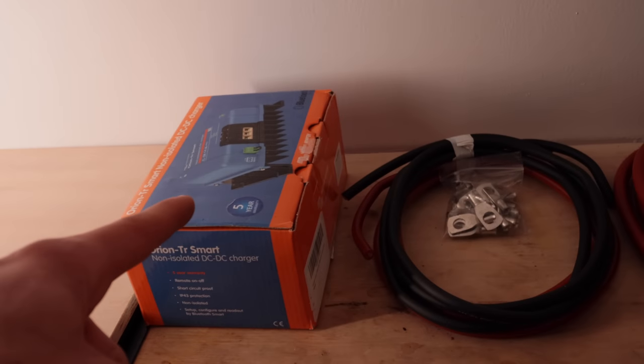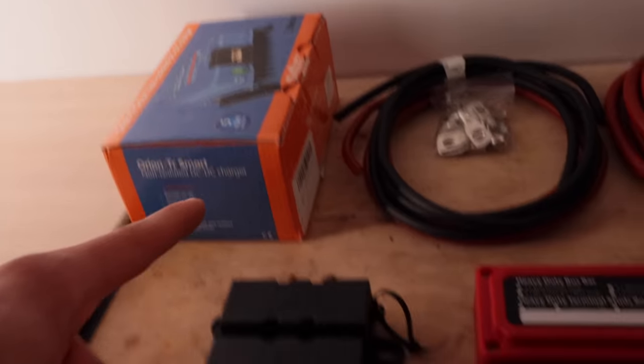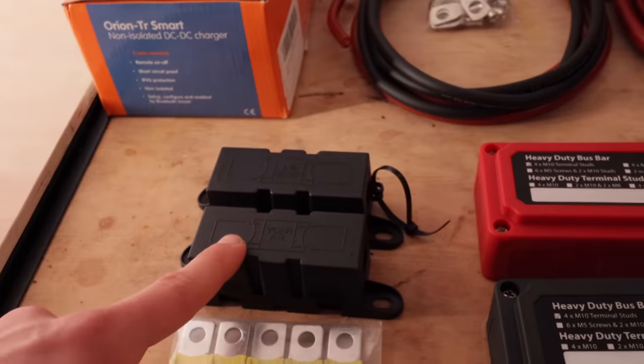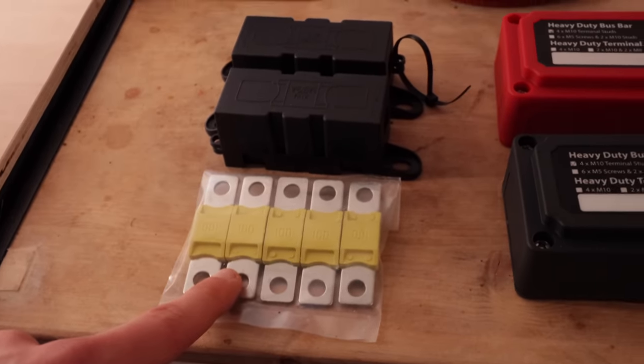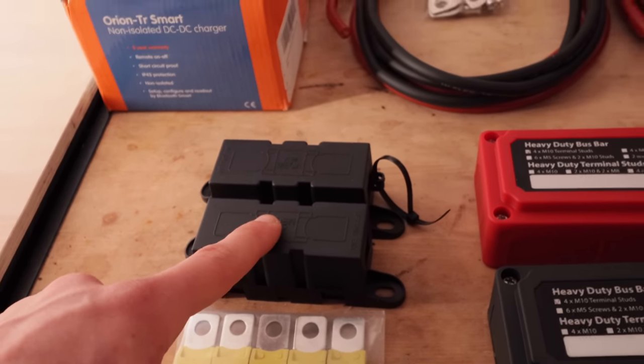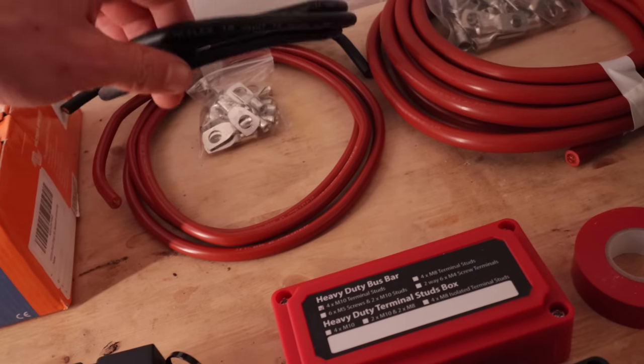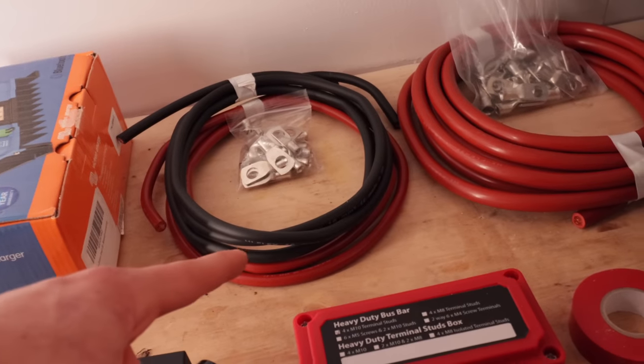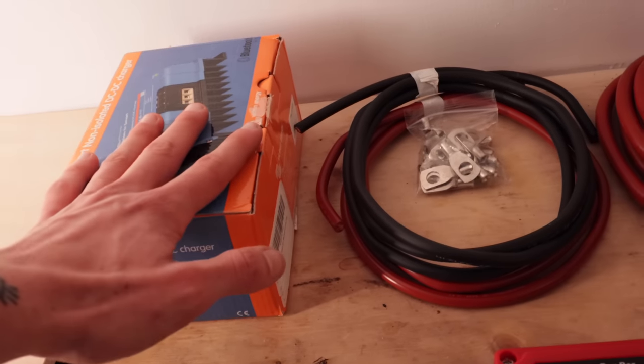So from there into those, we're going to need something to stop if there's a surge of power. That's these bad boys, mega fuses. We're going to run that wire through a mega fuse box with a 100 amp fuse. From this one, it's going to split into two wires, the red one, because that's positive coming out of there, and that's 16mm wire. That stuff's good to about 110 amps, and that's what's going to split down to go into these two.